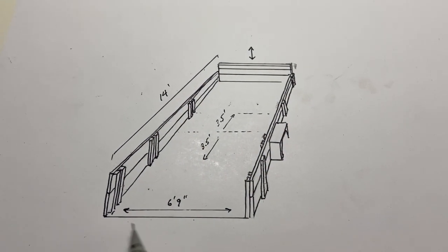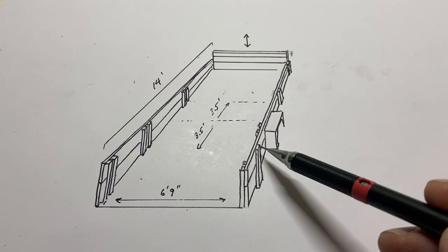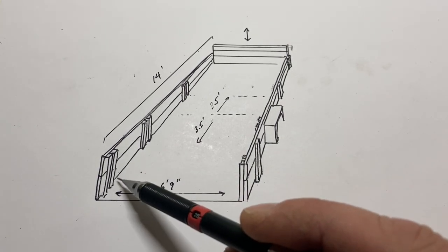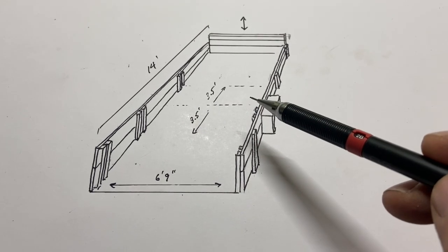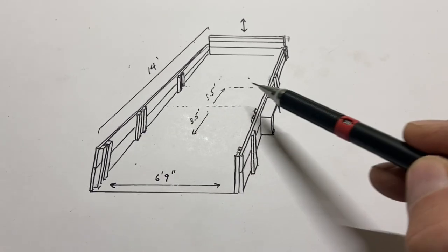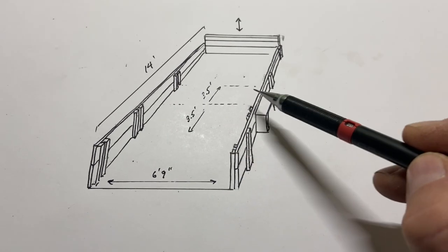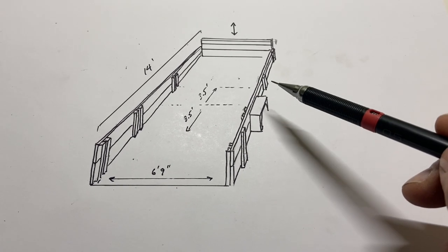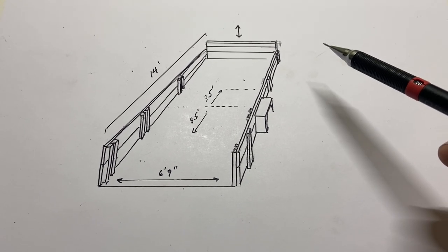So this is what I think I'm going to build. The trailer is about seven feet wide by 14 feet long. I'm going to use two 2x10s to make the walls, tied together with stakes made from 2x4 that fit into the stake pockets — there are three of them. I'll also make 1x slots that allow me to move the front and back walls depending on the load. For heavy loads like gravel I'll use just the small center section directly over the axles — about three cubic yards. Two yards of gravel is probably the most I'd feel comfortable carrying, which is about 5,000 pounds. I plan to paint it black so it looks a bit more like the actual trailer and not quite so redneck.